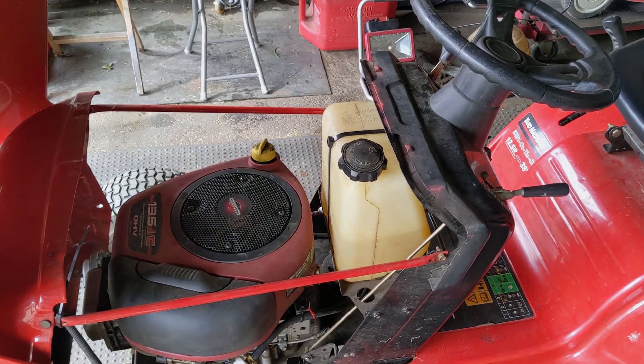So how do we properly clean out a gas cap? What you're not going to want to do is take a compressor and blow all the way through, because you could end up pushing that debris into the inner side of the cap, which actually has a soft rubber insert. On some of these the insert is removable — you can simply peel it out, rinse it, blow out the debris, and push it back in. This rubber insert has three holes where air would vent into the tank. It's held in place by a little barb, so air comes in from that hole, goes underneath this plastic insert, and then vents through those holes into the tank.